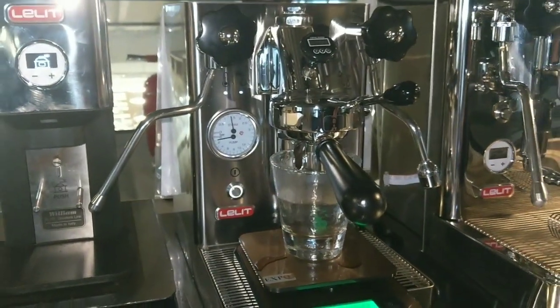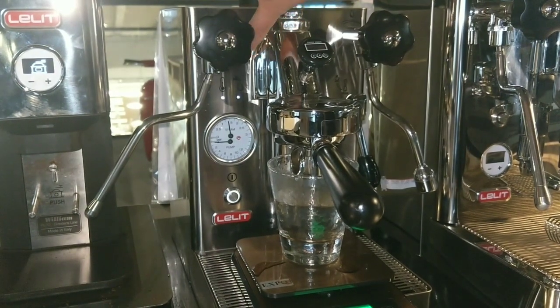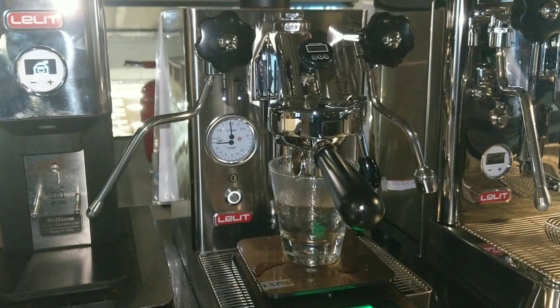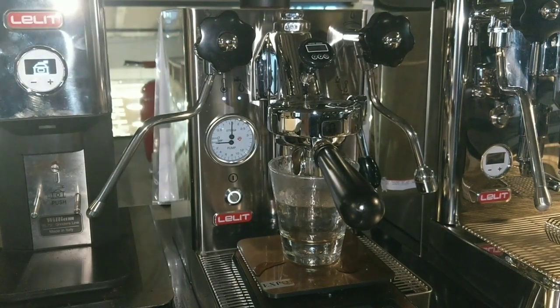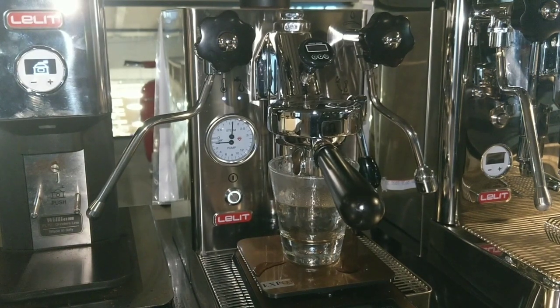After 120 grams of water, the ready LED starts blinking. In this case I can deliver coffee, but the machine detects a lower temperature in the exchanger, so the ready LED starts blinking. I have to wait until the temperature in all the siphons increases back to 91 degrees, which is the temperature in this setting.